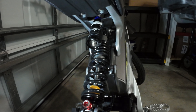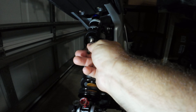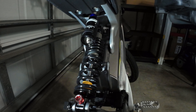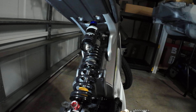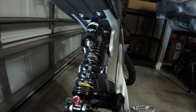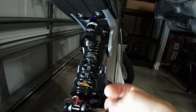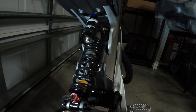If you have anything that's a nipple, or anything that attaches here that doesn't push the valve in, that will get the job done. Even this other extension I used earlier — if it threads in, you will lose all the air. All you need is something like this. Thread it in; it still has the valve in the valve body, but once you attach it, you're good to go. Apply air pressure — no more cavitation.